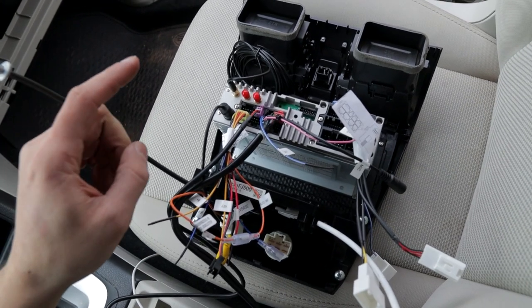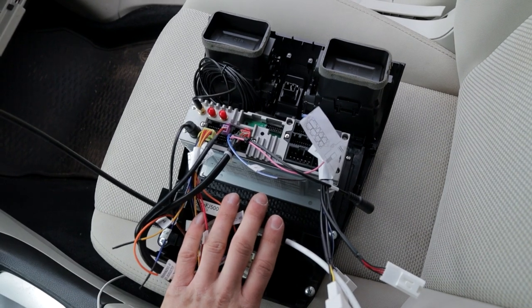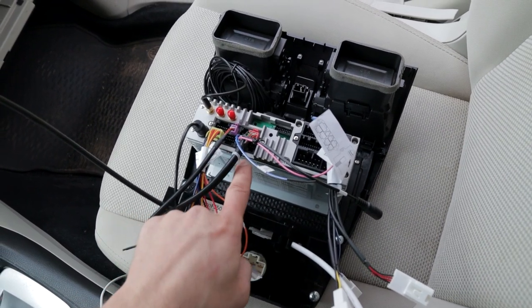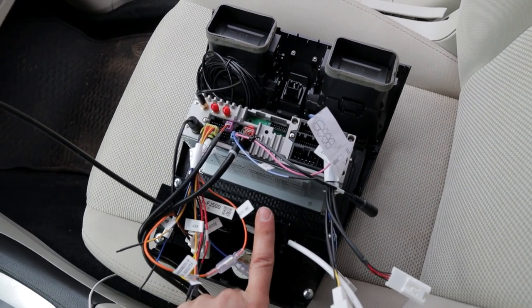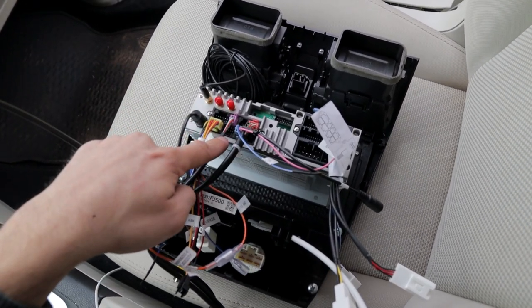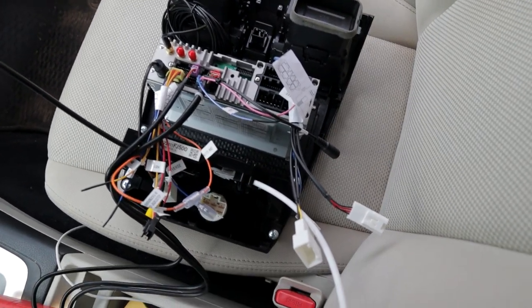There's also one more connection for a SIM card. This is really important: if you're planning on using your phone for the basic functions — Android Auto or Apple CarPlay — you don't need any of those three: not the two 4G harnesses, not the antennas, not the SIM card plug. If you plan on using the onboard navigation and buying a SIM card data plan for this unit, you can do that. Otherwise, just use your phone's mobile data through Apple CarPlay or Android Auto. Let's get this installed.